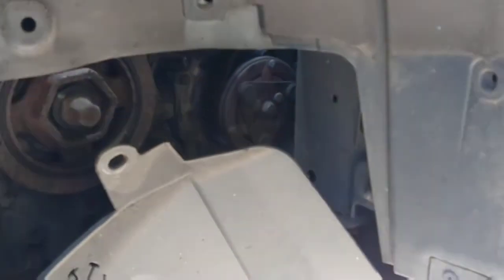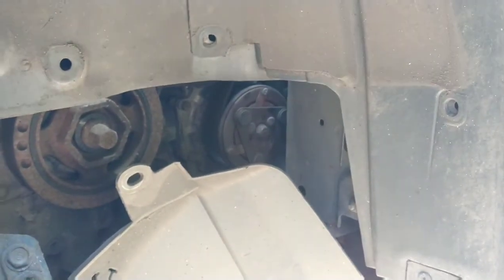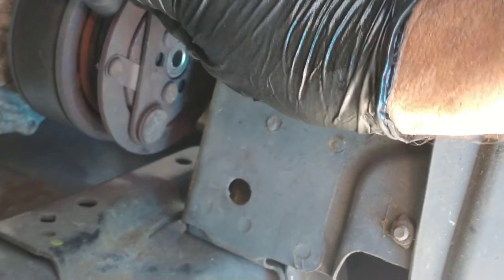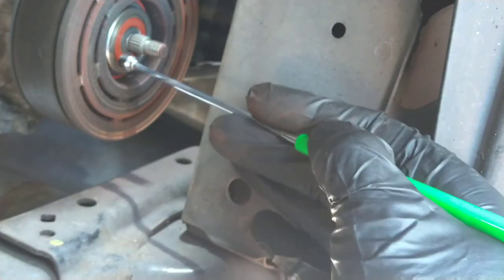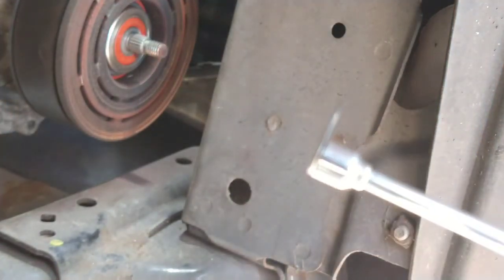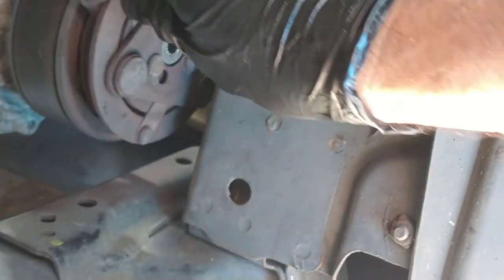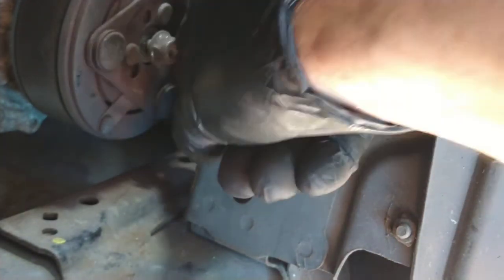Just down in the footwell and I'm going to see if I can take that plate off the front of the compressor — see if there's a shim in there, and if there is, take it out, reduce the air gap, and see if we can get the compressor back on. Undone the nut on the clutch plate. Take that off gently. Nothing on the back. Let's have a look, see if there's a shim in there. Yep, there's a shim. Take that out. Pop that back on — still looks like there's a gap there. Pop the nut back on and we'll see what happens.